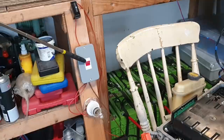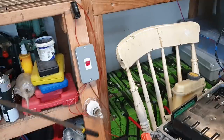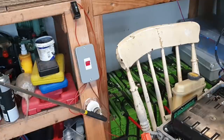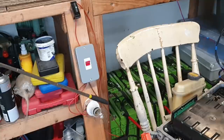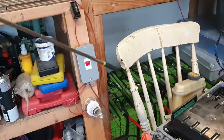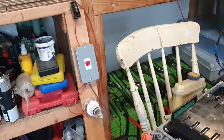This switch here is connected in parallel with this lamp, meaning that I can choose to turn that switch on and it will bypass our filament lamp, basically shorting this circuit out, and meaning that the effective circuit then is that our high voltage positive comes in, goes through the switch, goes through the fuse, and goes to our inverter converter. Now, the purpose of this is twofold.